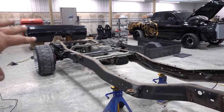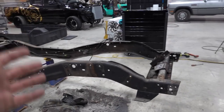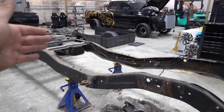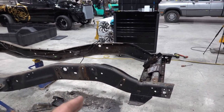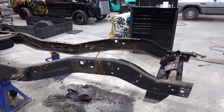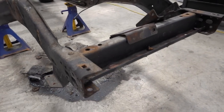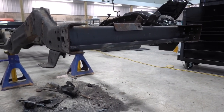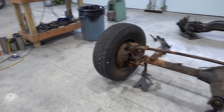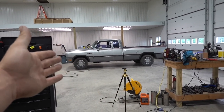But I think we're gonna leave the rear alone for right this second. Once Charlie comes, we are gonna do some stuff in the rear and change it up. But for now, this is kind of what we were after. That way I can roll the front axle in, we can get all the suspension pieces mocked up, all that good stuff. We can change our cross member here, the transmission cross member. So basically the transmission cross member and engine cross member are now able to get the new units put in after we clean up. But torching the rivets out wasn't that bad. We also removed all the suspension and the steering. Obviously, you can see the steering and these big clunky braces here in the front. We got rid of those last night as well. So we got a little bit of work left to do on the front axle, then I'm gonna call that good. And we've got the other first gen in here, and we're gonna be doing just a little bit of work on that, I believe, here at the tail end of this video.